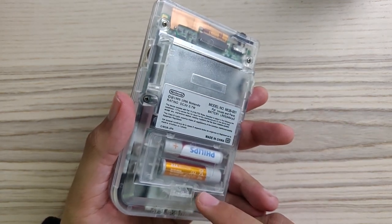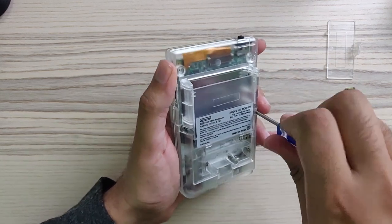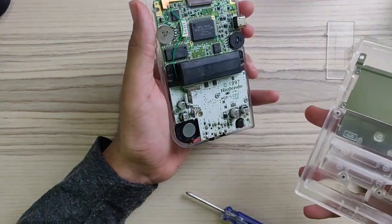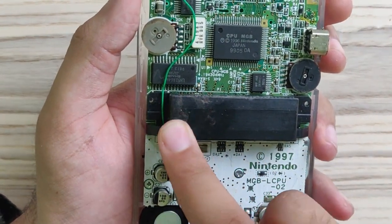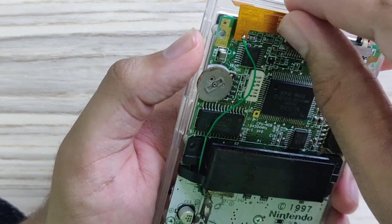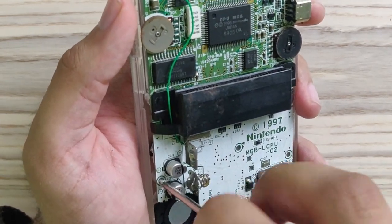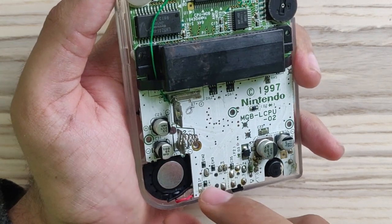Let's take a look at the inside of the handheld. There are six screws holding down the back of the case — two of them are tri-wing and four are Phillips head, which is not the original assortment of screws but does the job. The case is in very good condition because it's a knockoff case and very new, not really the original casing. I noticed on the inside that the cartridge holder connector is not clean, but you can scrape it off without a problem. For the rest, the PCB is very clean with nice solder points that are not rusty. To lift off the PCB, we need to unfasten three screws. The speaker is not original — it's a new speaker, probably from a cell phone — but it does the job.